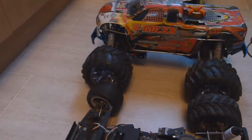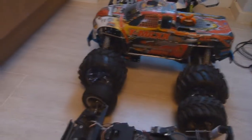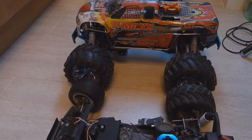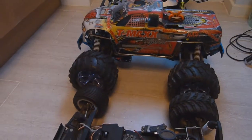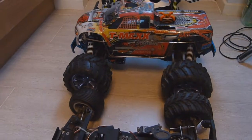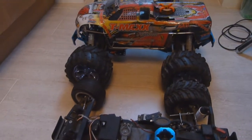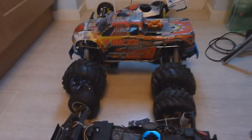I'm also going to change all the skid bars, or the skids underneath, to plastic, because I found out aluminium does not bend back. When I was growing up, aluminium was just the best thing, but I'm going to change the bits that get hit the most back to plastic. The only bits I'm keeping aluminium are the bits that take force, so the suspension struts, the bulkheads, and the main backbone of the car is going to stay aluminium. So that's another project that's coming up in the next few weeks, hopefully, when I find a new steering linkage system for it.